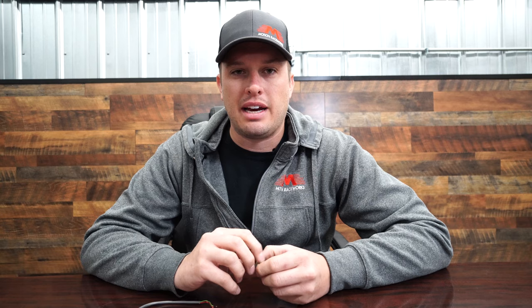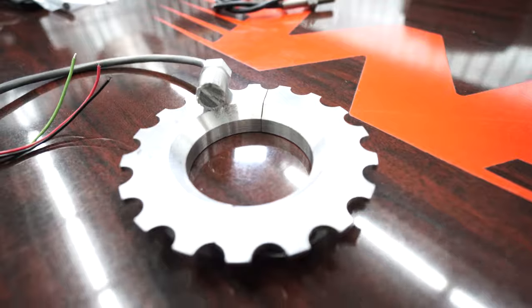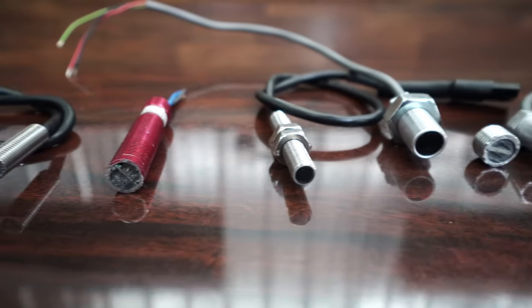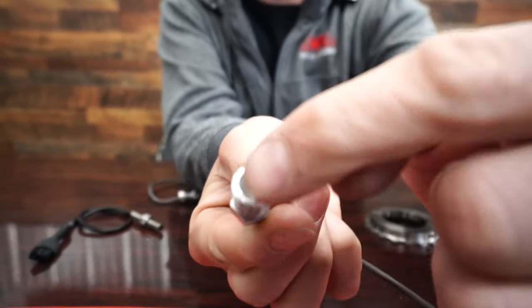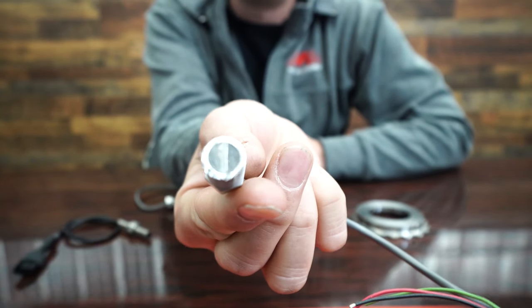The way these sensors are designed, they produce a cleaner signal than a traditional magnet style sensor and they work really well about 99.9% of the time. What we found is that if you actually cut apart the sensor — and I did take perfectly good sensors and cut them apart — you'll see inside there is a small strip, and that is your magnetic element.